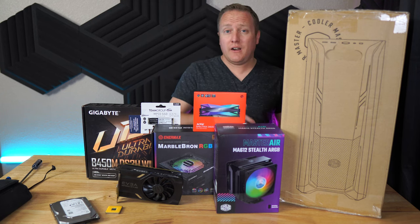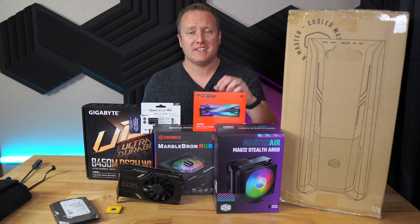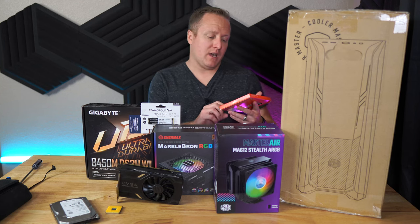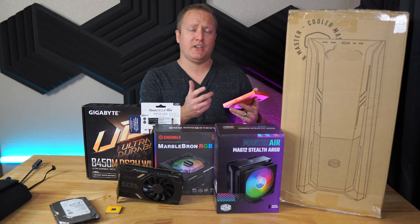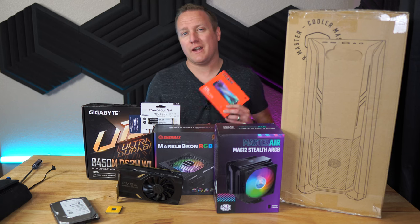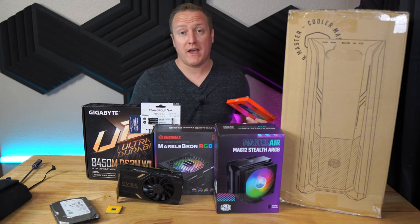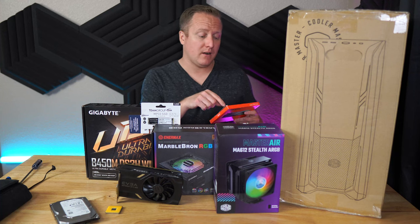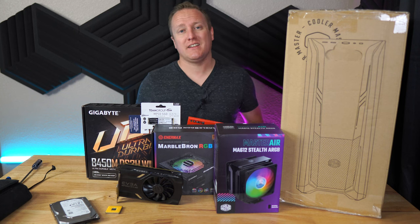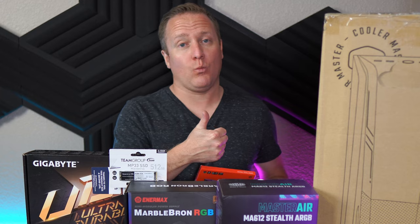So moving on into an area that is going to be a pretty significant upgrade, where the HP machine seriously lacked is in the memory department. So what we got here is a kit from XPG, their Spectrix D60G. I've never really heard of it or used it, but I've seen it online before and I thought it looked pretty sweet. But anyway, what we're after was just more capacity and faster speed. So what we got here is a 16 gig kit, 3200 mega transfers at CAS latency 16. So we're doubling the memory capacity and we're definitely way up in the speeds.